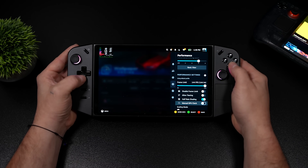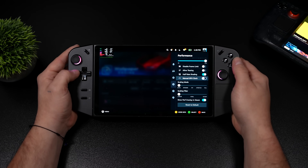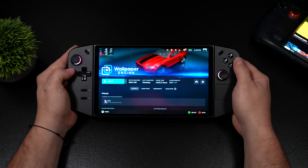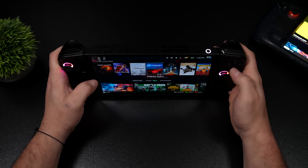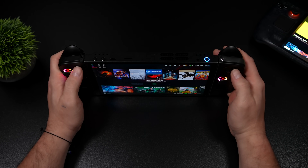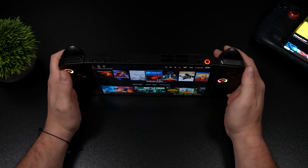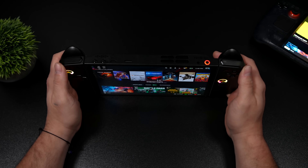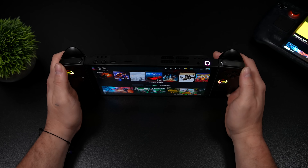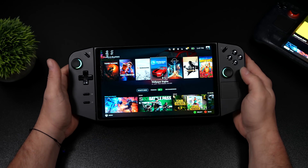This does not have a variable refresh rate display — it's an 8.8-inch 144Hz display. You might notice that our TDP is completely missing from this menu. We do have iGPU control, but we can only go up to 1600 megahertz. Luckily, with the Legion Go and even the Legion Go S, we can actually adjust the TDP quite easily. If you check out the light up top, hold the left Legion button and press Y. There are four modes: blue is quiet mode at around 12 watts, white is balanced at up to a 15-watt TDP, red is around 20 watts boosting up to about 23, and purple takes us up to 35 watts. That red and purple are a little all over the place. When we go to white, we're at a 15-watt TDP matching what the Steam Deck puts out.